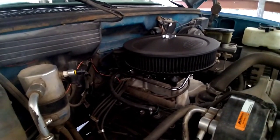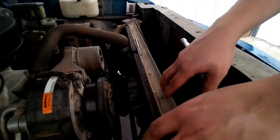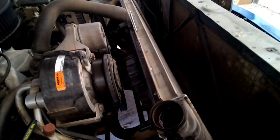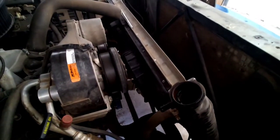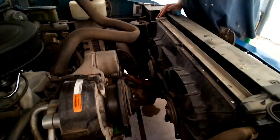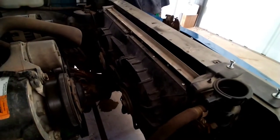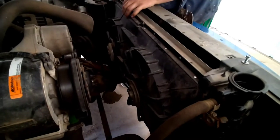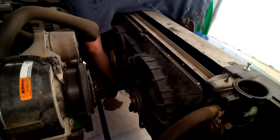While he's getting this radiator out — he should have gotten the fans off before he took the mounts off, but he didn't. Now we got lined up — what you want to do is take your radiator hoses off first. I've got these e-fans with little brackets that I made and riveted on. We're going to get a drill and drill the rivets out. I don't have any transmission cooler because I've got a manual transmission in this truck, and some of these trucks came with oil coolers — I don't have that either.